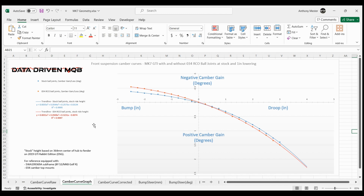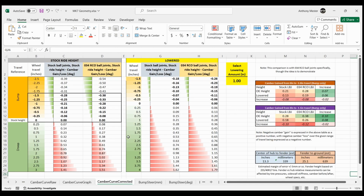I'm pretty happy with 99.95 to 99.97 as far as this line formula being a fit for the model. I fed those trend line formulas into this third spreadsheet, where you can see the stock ride height camber change on the left. The right side is selectable for ride height based on how far you're lowering the car, because all that happens is the curve doesn't change — just where you're starting out in it — so it just changes your zero reference point.